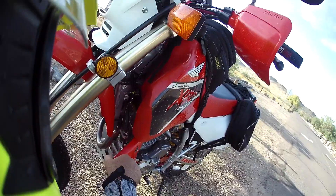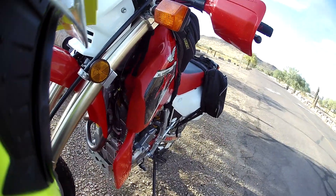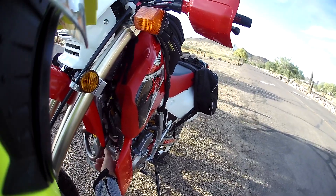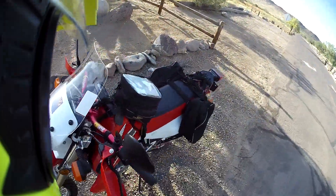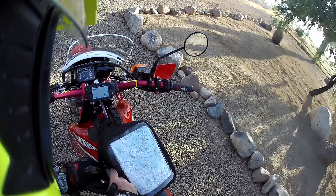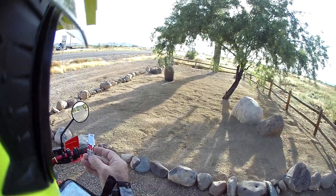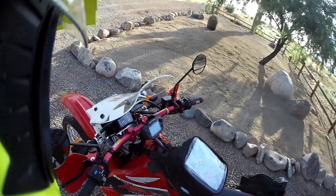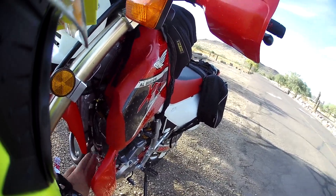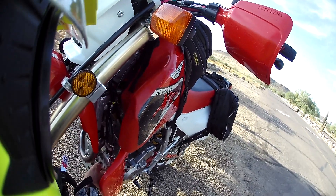The other thing I did is I wanted to get another temperature basis between this and the DR-650, because the DR-650 has just a huge cooler on it. My sender unit that reads up to the Trail Tech Voyager will work on this, but it's a different size — it's a larger 12 millimeter for the DR-650. So I'm using 3M foil tape and holding it on with that. It's actually holding it very well, so it's going to read off the side. This way I can duplicate the readings on my DR-650.